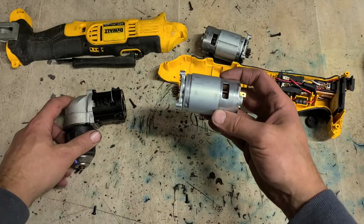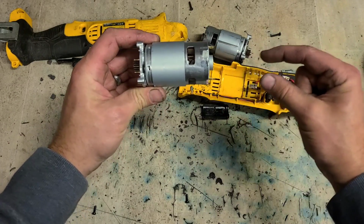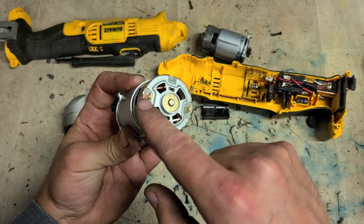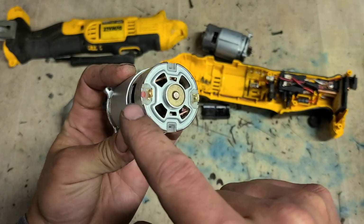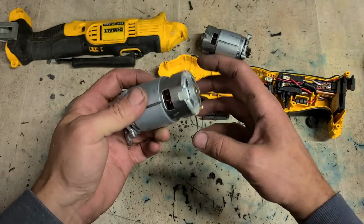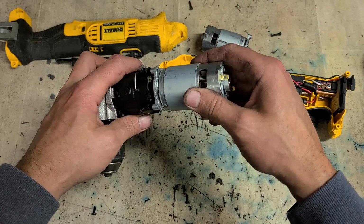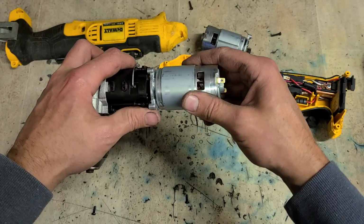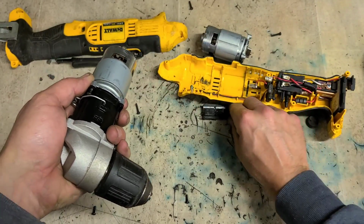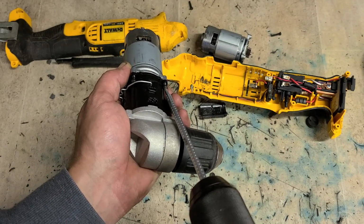Now before you reattach it, make sure you have it sitting in the right orientation. You don't want it sitting like this because the leads are going top and bottom. Just be careful where you put this little red mark here. One connector has a red tick. That's to show that it goes to the red wire. So that has to go on in this orientation. So put it on like that. Give it a little twist. It drops on. Then all you have to do is tighten up the screws.